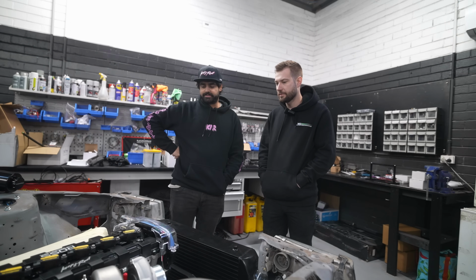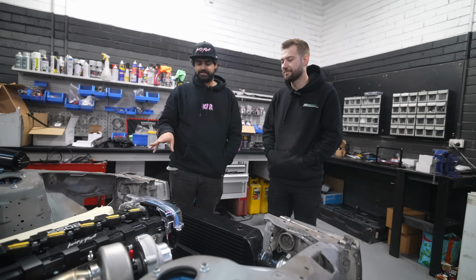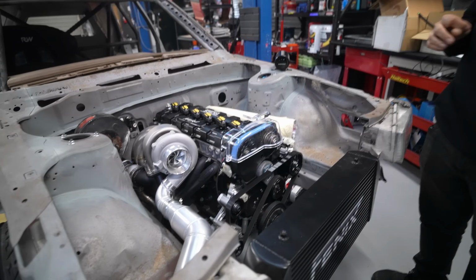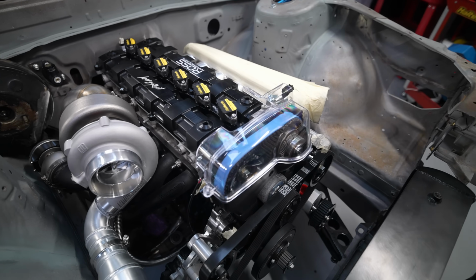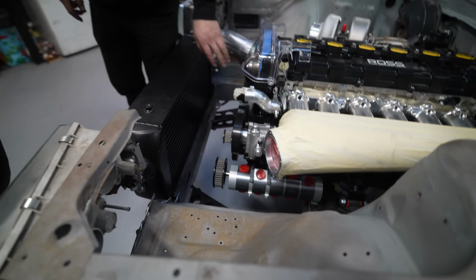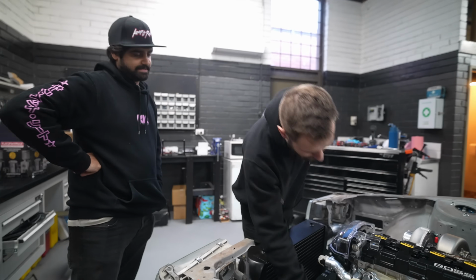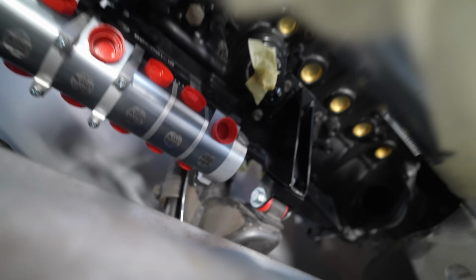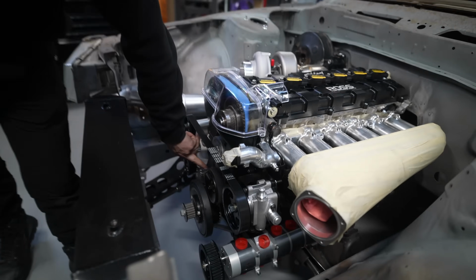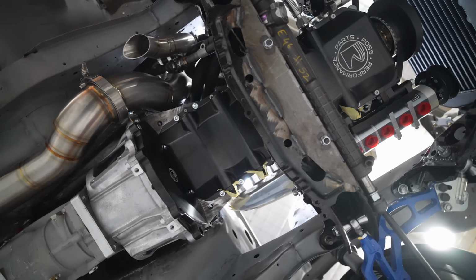So you got to explain just quickly, because I feel like we've really not touched on anything to do with this motor being a dry sump, and I know nothing about dry sumps. Ross has hooked us up with the balancer, dry sump, and the rocker covers. Yeah, they supplied the whole kit, so got the massive dry sump tank that's mounted under the dash there. They also have the full billet oil pump delete, which is kind of hidden now, but it replaces where the oil pump would go. It's a neat bit of kit. They've got the oil filter housing adapter, so that's where we'll feed our oil pressure in to the engine. It's also got a Ross billet tensioner bracket, which is hidden behind there as well. Heaps of Ross goodies on this thing, but some of the billet stuff is pretty insane.